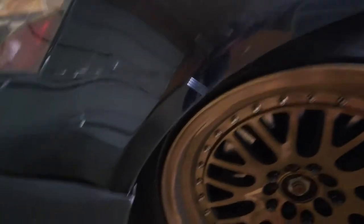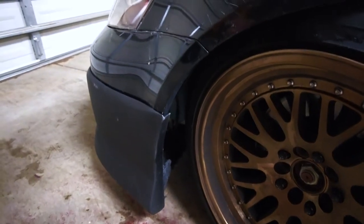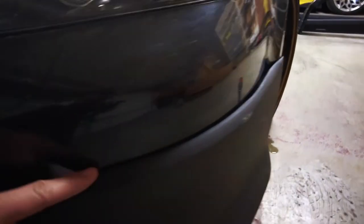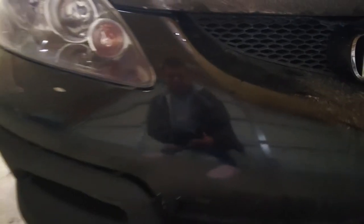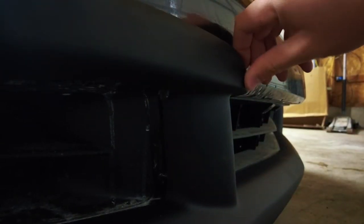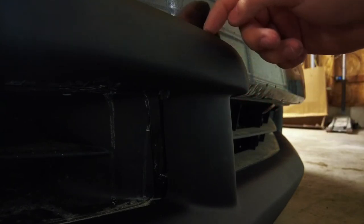All right, so here is the fitment without making any modifications to it, which I am going to have to do — but you have a gap here. Pretty good fitment throughout here, and then this side is okay. Over here is where it kind of gets really off. So you kind of just got to look and see where you need to trim it. I think I found it here — I'm going to have to trim this piece right here so it goes back a little bit more, because we've got that bad gap in this area. It needs trimmed up in here to get this flush.